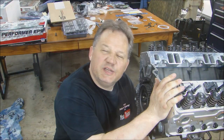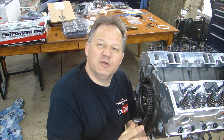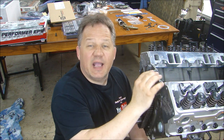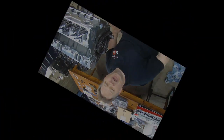All done. The cylinder heads are installed a little earlier in the build because I have to measure pushrod length. It's not a standard cylinder head and I don't have standard rocker arms — it's a stud-mounted adjustable rocker arm. I've got roller hydraulic lifters, so we have to measure the pushrods so I can get those ordered and continue the build. We'll do that in the next video. Thanks for stopping by Pete's Garage.